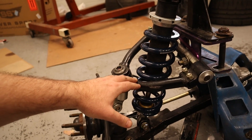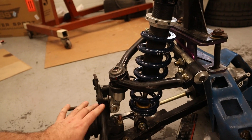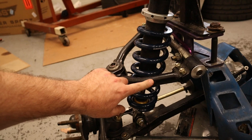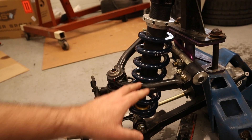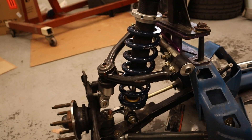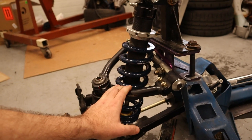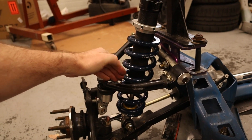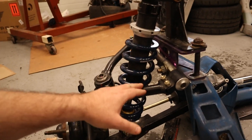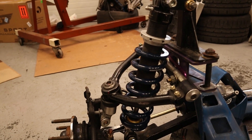Another thing about these control arms is they are a little on the larger side. With the factory spindle, I'm basically at the limit of my tires — you can see the tires have contacted the upper control arm. I'm at a 10.5 inch width wheel at the moment and I can't go any larger or I start hitting this upper control arm. One option is to get a different upper control arm design — more straight to the ball joint to get rid of these bends and curves — but that would require a completely different manufacturer or a custom design.